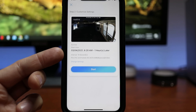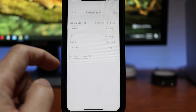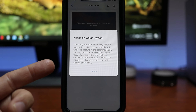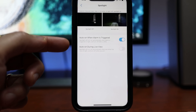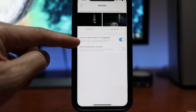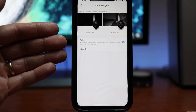To test the timelapse I'm just going to do sunrise, where it shows the interval and estimated file info. You can change the settings if you want and click start. You do need to process it after it is done — it is like Wyze's timelapse on their cameras. Under advanced settings you can toggle on or off audio recording, the spotlights to automatically turn on when motion is detected or when live viewing at night, and infrared LEDs — set to automatic or stay off if you want color recording at night.